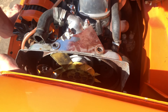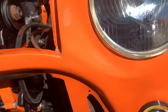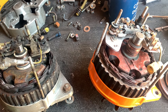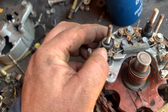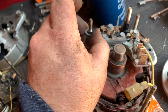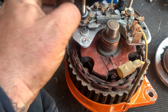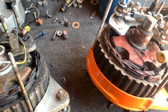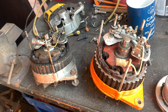You can't buy them like that. Right — rad's out, fan's off. Now to take the alternator off. This alternator didn't work — I'm pretty sure because of my own doing. I didn't fit the little insulators to the main battery post and the warning light post. I think where that insulator wasn't on there, the nut was earthing on the body of the alternator, holding the circuit down to earth. My own fault. Only one way to find out — put it all back together and hope it works.